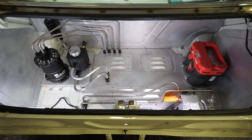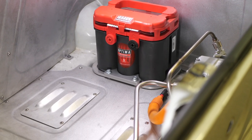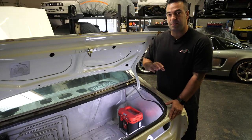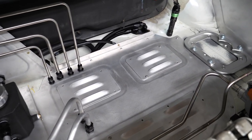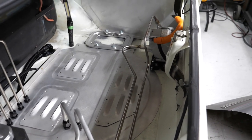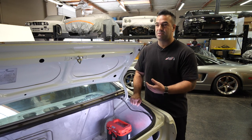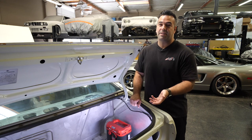Getting into the items in the trunk — it's just where everything fits well. We have the Optima Red Top battery. Because we don't have spacing or pulley fitment for a belt-driven AC compressor, we're switching to a 12-volt electric AC compressor system to run with Vintage Air or a factory AC system — it's easier and we can mount it wherever we want. All that load is carried by a DC Power alternator, a 270-amp unit. We knew we'd be throwing a lot of load with electric power steering, and once we couldn't fit the AC compressor belt-driven, we went electric AC, so we needed a very high-amperage alternator. DC Power offers that specifically for the RB26.